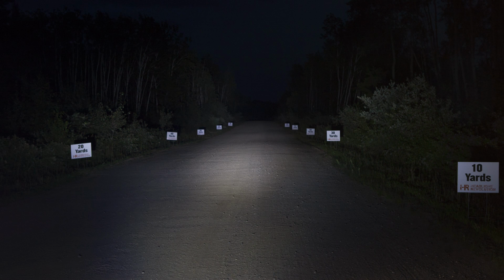When you turn on high beam, it does get pretty impressive. Tons and tons and tons of light up at the top of the tree past the 100-yard mark, and a lot more light in the foreground. But again, look at your ditches, especially right in front of your vehicle there. It's still practically nighttime at the 3 o'clock and 9 o'clock positions. Yeah, it puts out a lot of light. We have 1,330 lux and 5,600 lumen, but the design and the engineering just isn't up to par with other top tier headlights that are available. It's cheap, it looks cool, and that's as far as my recommendations go.